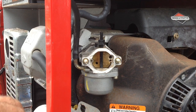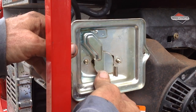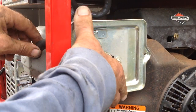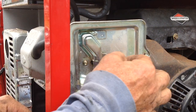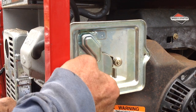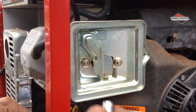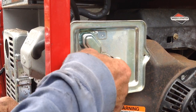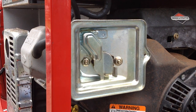What I'm going to do is give this back dry — I'm going to run the gas out of the bowl and have no gas in the tank. If there's a hurricane, he can put fresh gas in and it'll start. If I leave fuel in it, it could be 12 months before he uses it again and we'll have the same issue with a plugged-up carb with root beer in it.